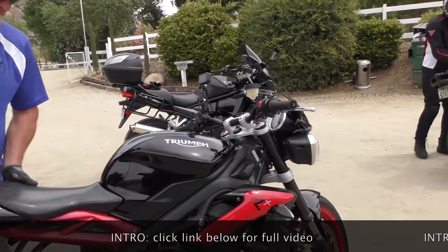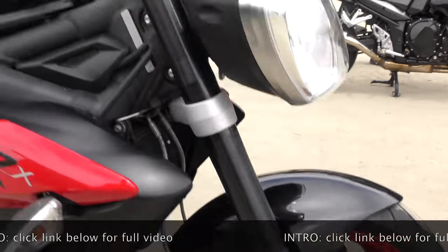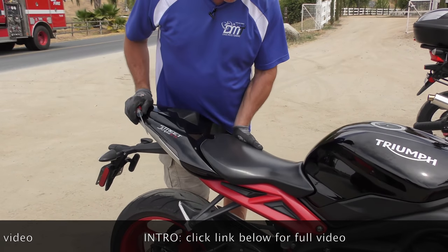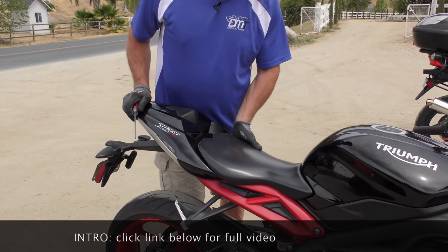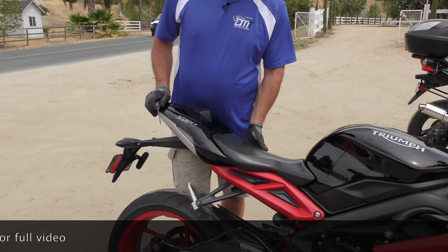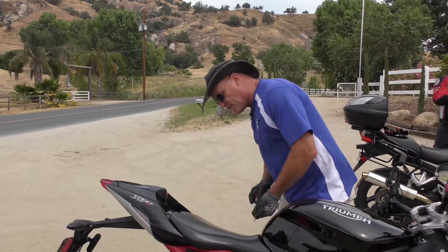So after the ride, that's where we got on travel, but it's really stiff and harsh on the bottom. The rear shock, as we expected from yesterday, is super soft and bouncy from when we did the six-step setup to rider weight. So we're going to tighten up the rear shock with rebound and compression.